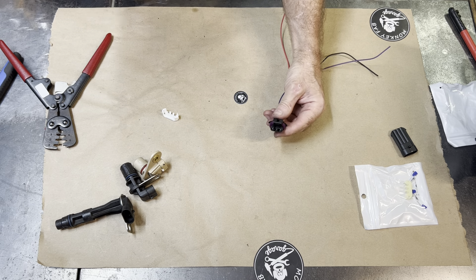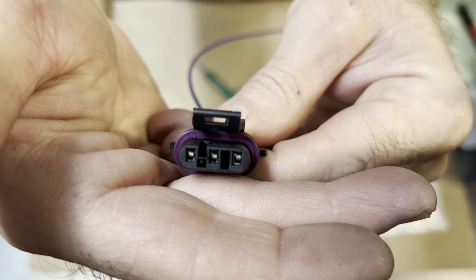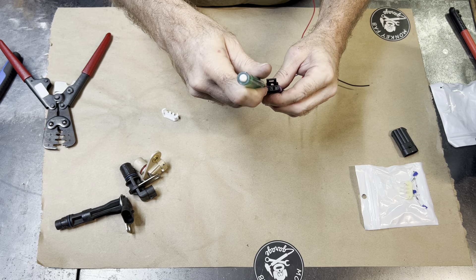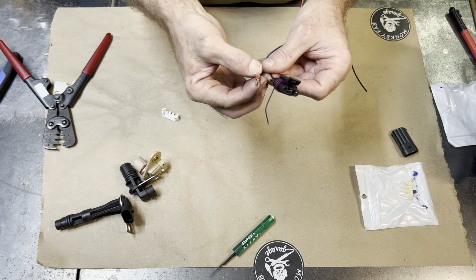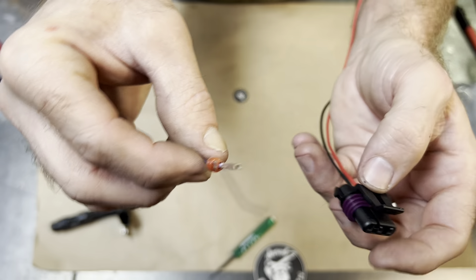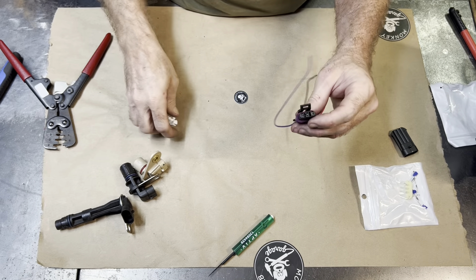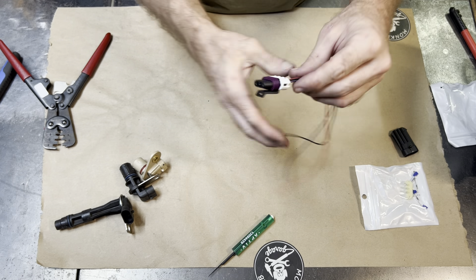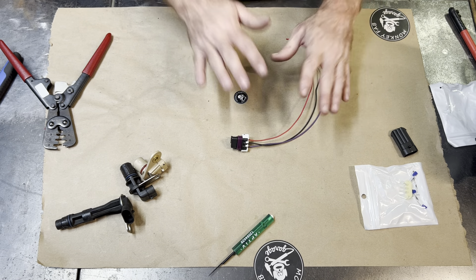To depin it, you just stick your depinning tool up. In the top you'll actually see a little notch for your depinning tool, so just stick it in there, work it in gently — you don't have to kill it. When you feel it go pop, you know you're depinned. That's how you depin those. I became a pinning and depinning expert trying to figure out a cranking issue — I had a coil miswired. I thought maybe I had the crank signal off, but the coils were actually not working.